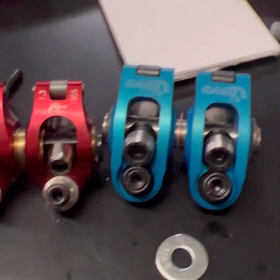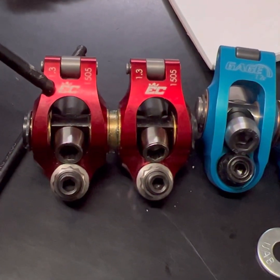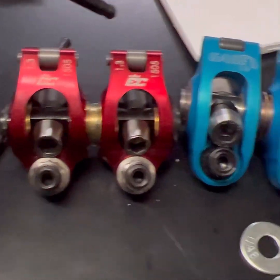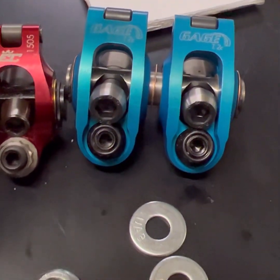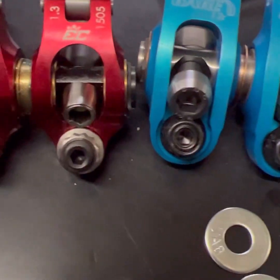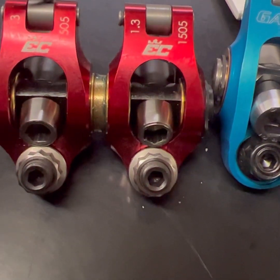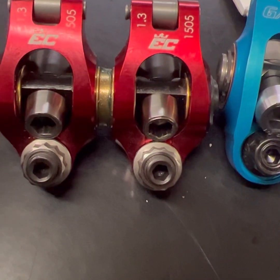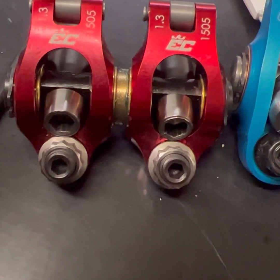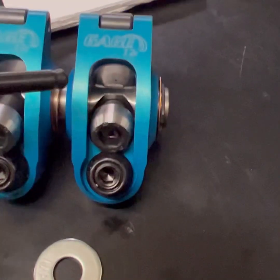Now on the MoFlo, I wanted to use the EC rockers. These are beautiful — they're lightweight, really nice. One thing about them: if you look at the roller, it does not sit proud of the rocker body like the gauge rockers do. The gauge roller is nice and big. Since I had somewhat of an alignment issue with the ECs, my biggest fear is the roller walking over and the valve tip not being centered — the rocker body's going to rub. Putting a lash cap on it, which I hate doing, is just going to make it worse. So I tried putting the gauge rockers on there.